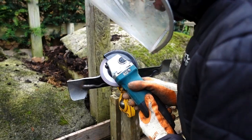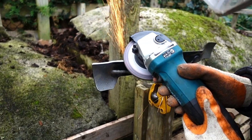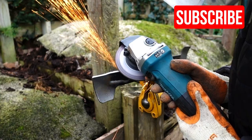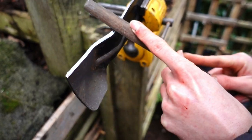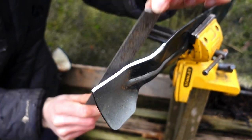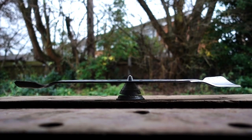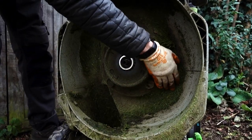When it comes to sharpening the blades you can do one of two things. I personally use an angle grinder with a grinding wheel and I just work to get rid of any of the burrs, bumps, and divots in the blade and try to get it nice and sharp, then I go over with a file just on the back edge to tidy up any burrs. It does a really good job getting it nice and sharp, but it does take quite a lot of metal off so you'll wear through that blade a bit quicker. The other way is just with an old-school file to do the fine details and make sure the blade is balanced. These little blade balancers are really useful as well when it comes to that.